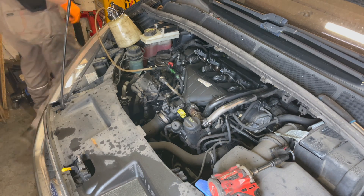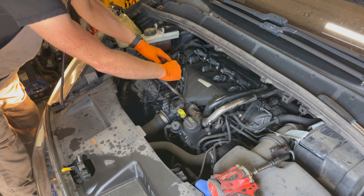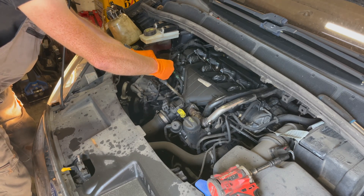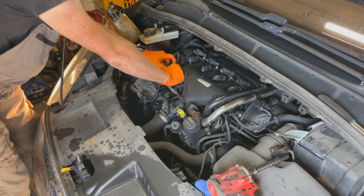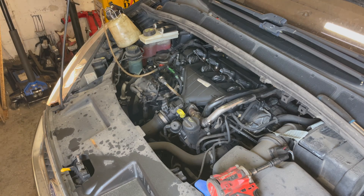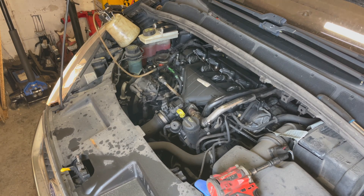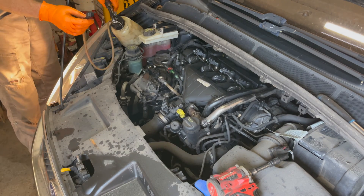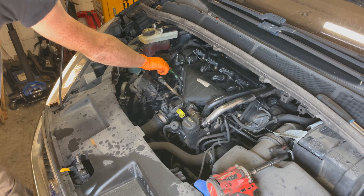You can see some diesel coming through now. The next thing to do is to start the engine, leaving the vacuum pump connected. Then very quickly take this off and put this on like that. I must have a little bit of air in there still, so I'm just going to keep sucking through there. Obviously a little bit of air got in — just swap that over like that. Vacuum pump off.